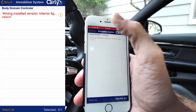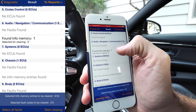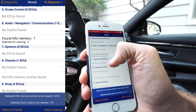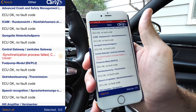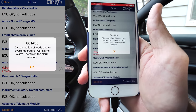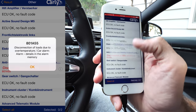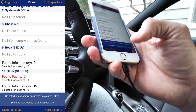There's the immobilizer ECU — and here's that wrong interior light thing I was talking about. Interior lighting is like a standard issue with the body module, no big deal. There's also an audio PIA report function fail — not quite sure what that one is. Under other ECUs: load over temperature and car alarm. I set off my car alarm once or twice while jacking up the car — this car has a tilt sensor or shake sensor.